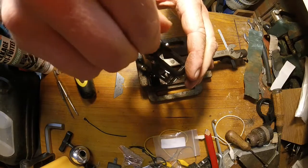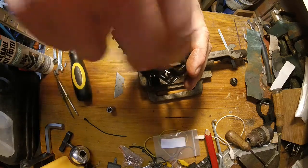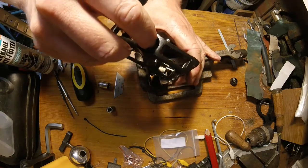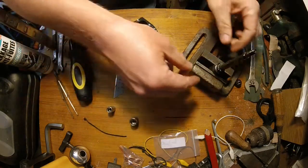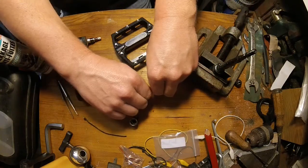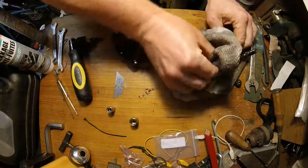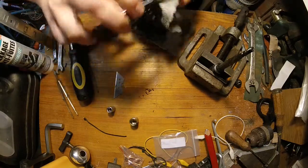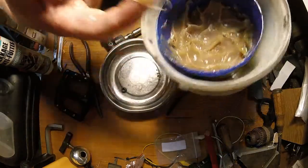It doesn't have to be the bearing grease used in bicycle bearings — it might have been factory grease used to prevent rust. If you don't extract the cup completely, you can retain all the balls inside the pedal. There is a seal on the spindle on the crank side, which I'm very happy with. I removed the seal a bit and collected all the balls. Just a bit of cleaning of the spindle — I did not put any white spirit or brake cleaner, because it's grease, not a gunk or residue, so let's leave it. Now I'm putting the ball bearing grease inside the pedal.